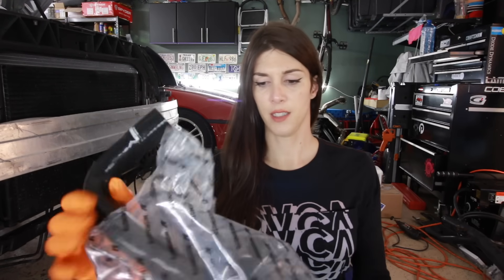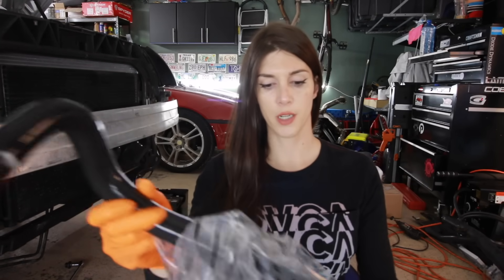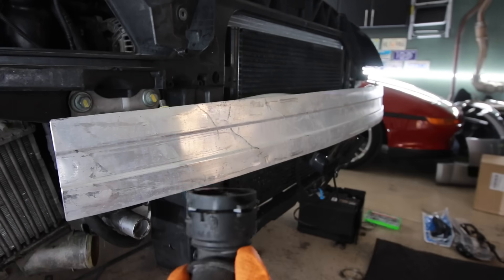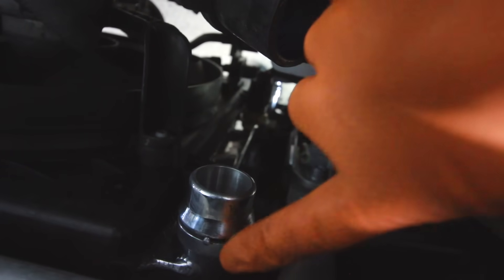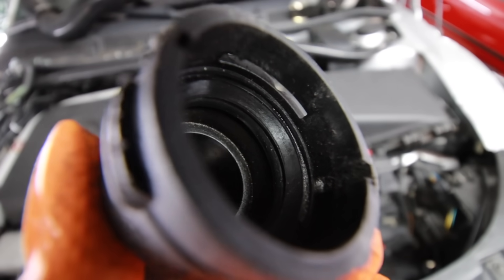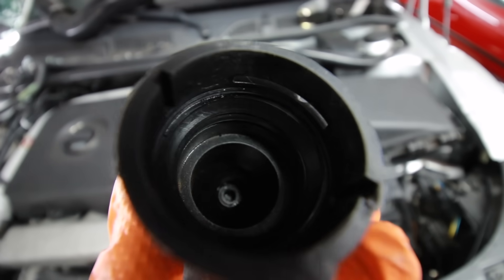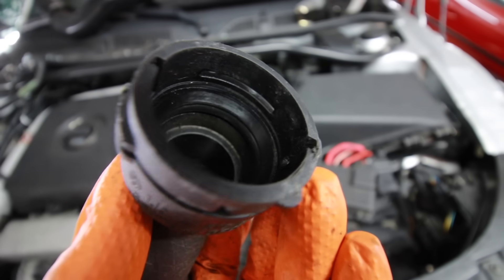Now that I got these two guys off. I have this bag of hoses for VCS tuning — they're Mishimoto silicone coolant hoses. I got upper and lower that I'm going to replace. See that groove on the top and the bottom? Those have to line up with these notches. Ideally before you put these back on you should replace the little o-ring that's in the center there. These ones don't look like they have flat spots, they're not dry and corroded or deteriorated. But I'll put them on there — if they leak, so be it, I'll get some new o-rings.